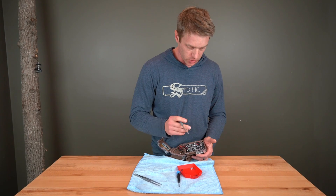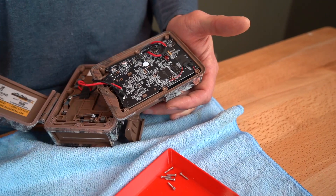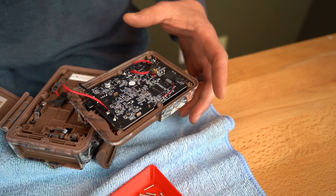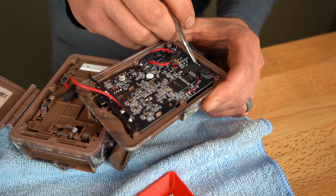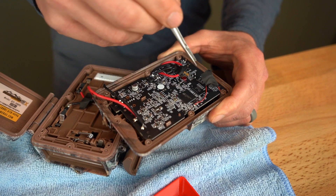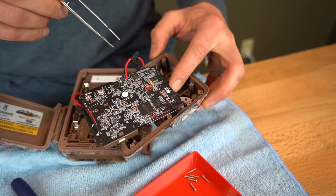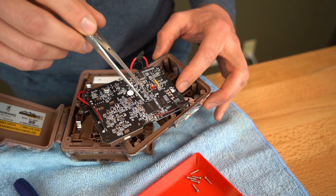There is this little piece of tape right here that I'm going to try to peel back. Once I get that peeled back, it's just so that I can get this kind of separated so we can get to the underside part of this PIR lens. So I'm going to try that — this is where tweezers and the small flathead might come in handy. Being careful not to disturb these wires any more than I have to. If I have to handle it with my fingers, I'm going to try to do it on the edge of the circuit board.